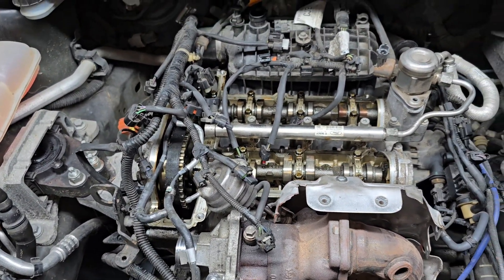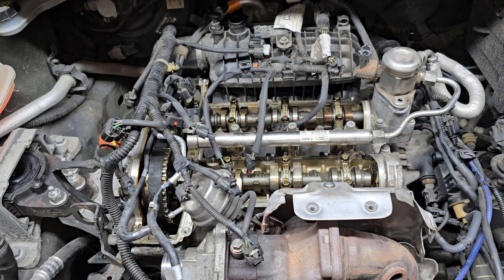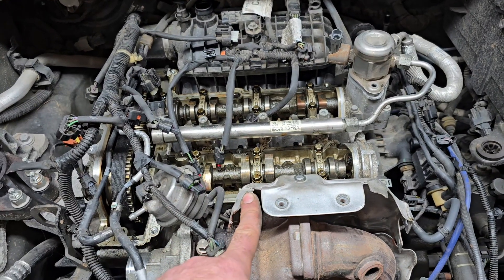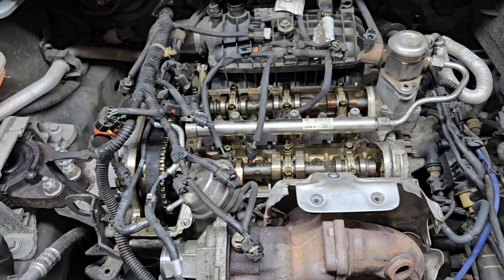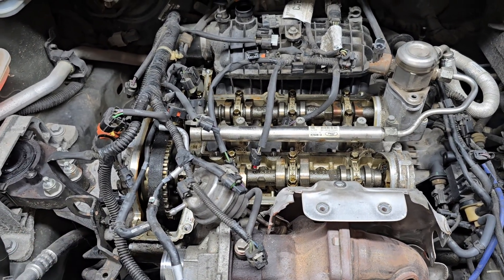On this engine I managed to put it back on time. But on cylinder number two we have zero compression. Numbers one and three have about four bar or two bar — they're very low compared to what they're supposed to be.